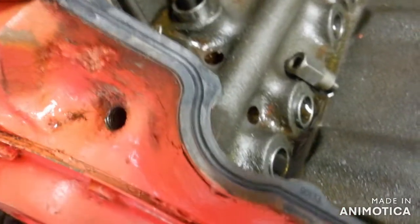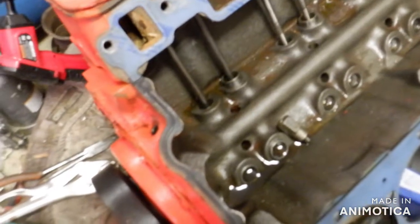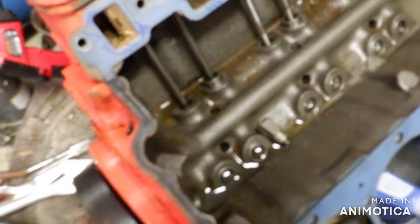All right, so I removed that oil plug — that's the end of the cam. I forgot to plug it when I spun it. And it definitely has oil, so I'll clean that up. This is progress. This explains why I do have oil on my lifters and on the camshaft lobes, but it does not explain why there's no oil going up top.